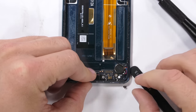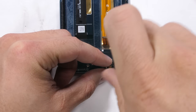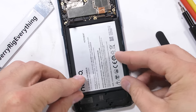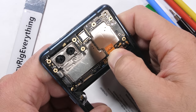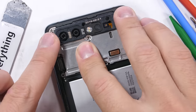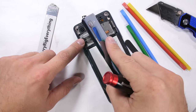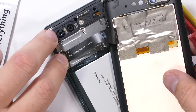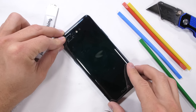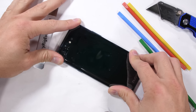The motherboard is back in place with its one screw, along with the charging port board and its coin-style vibrator. It's pretty ingenious to have screens on both sides of the phone — it definitely solves the notch issue and allows for better-looking, larger edge-to-edge front displays. It's always refreshing to see something unique and innovative in the smartphone world when most of the big companies are playing it pretty safe. The battery is back in place and all the ribbon cables are plugged in, including the battery ribbon which clips on last. The top metal plate with its little ribbon is back in place and the 15 screws for both the top and bottom boards are all screwed back in. Here's the moment of truth as we take the rear back glass panel with its AMOLED display and plug it back into the motherboard — it's got a silver metal bracket to keep the connector from coming loose. Just one rear ribbon to watch out for, like we would have anyway with a rear-mounted fingerprint scanner.